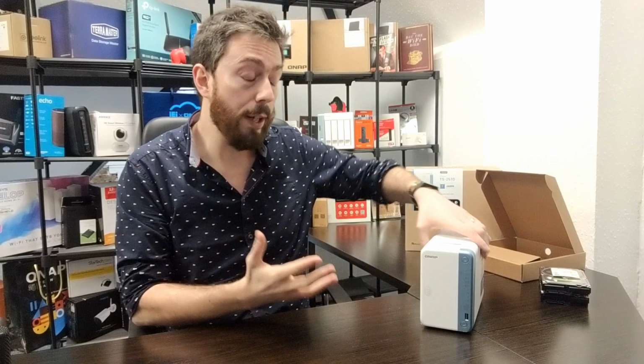But the CPU and memory inside this device are already a decent jump from its predecessor, and I will be doing a comparison video, don't get me wrong, but just to touch on that, its predecessor had a J3355 Celeron, so a previous generation CPU, and it arrived with DDR3L memory, so a lower frequency. So, more efficient, more powerful CPU, and more modern for applications, along with better embedded graphics and faster, higher frequency memory. So, to be honest, win-win-win-win-win compared to its predecessor. But what else has it got going for it in the hardware stakes?